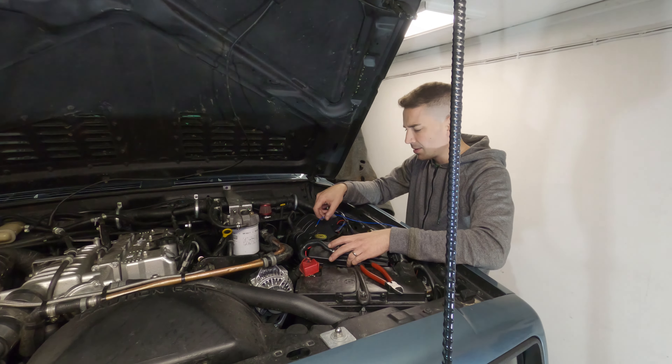Now I know what wires do what, the other side is obviously a quick job — plus there are fewer wires to feed through the fender. Now it's time to figure out where to splice in the voltage control wire. At first I try it on the main fuse box, which is obviously a fail because this comes directly from the battery pre-switch, meaning the lights would just be on all the time. So I'm taking apart the light housing and splicing the control wire onto the wiring harness itself, which is post-switch and should work.